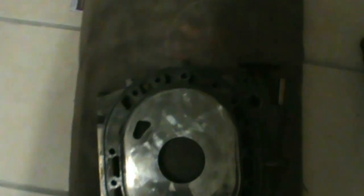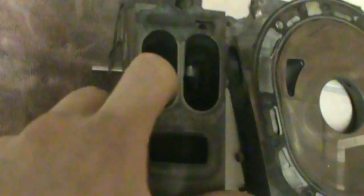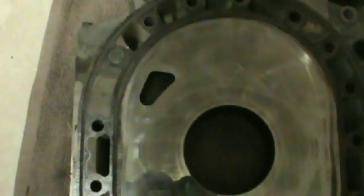This is the center iron here with the primary port. You can see on this side it has two combustion faces on both sides with the two ports there. That's the first place you start porting — get those all nice and free flowing and smooth so it leads into the actual combustion chamber nice and smooth. You can see it's not very smooth in there right now on this stock one. When you change the shape of these ports, it starts changing the actual engine timing.